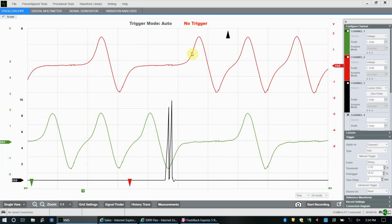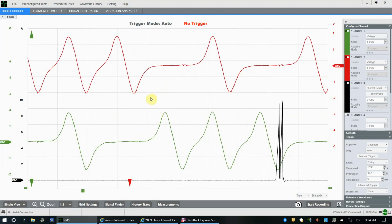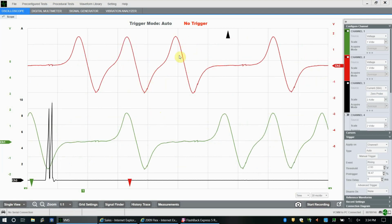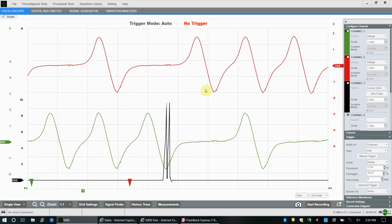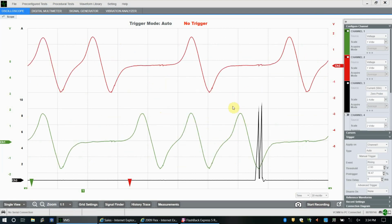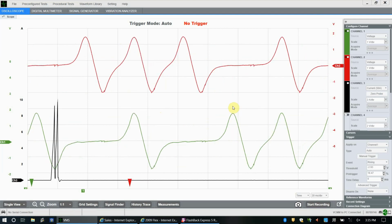You have to sort of focus your eyes on one spot and then focus your eyes on another and kind of follow all the way through. And it can be a bit difficult to diagnose an intermittent concern. Let's say we have a cam signal dropping out or whatever. There's a potential here for it to be missed, just with this data moving back and forth. So how you get around that is you set a trigger.